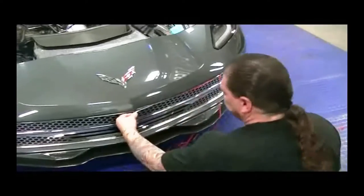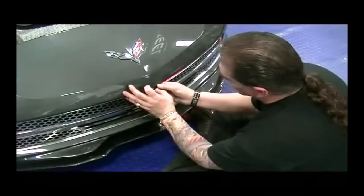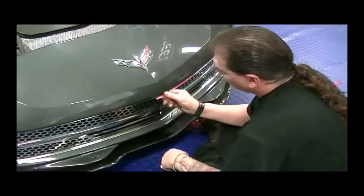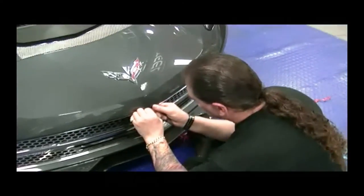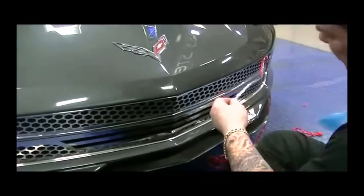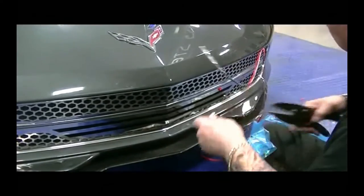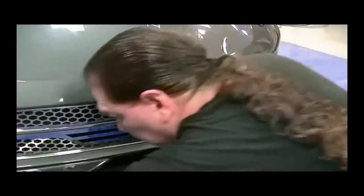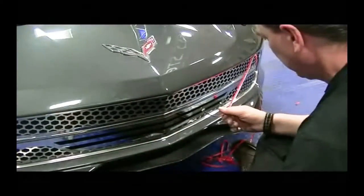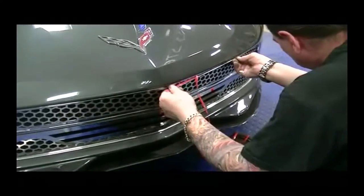Come to your start point, you're going to want to butt this up perfectly to the other piece of molding. And one of the things about vinyl molding like this is that over time, they have a tendency to shrink from heat and weather and stuff. So what we'll ask you to do is take a tiny little bit of instant adhesive, like crazy glue, and you'll run it up to your start point.